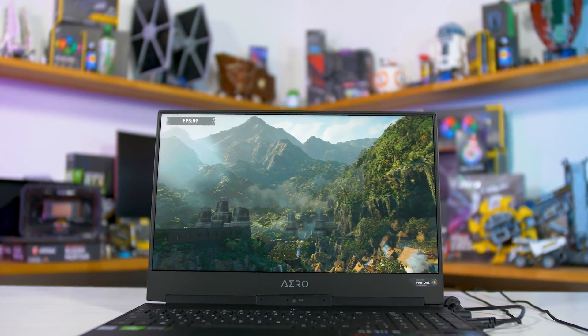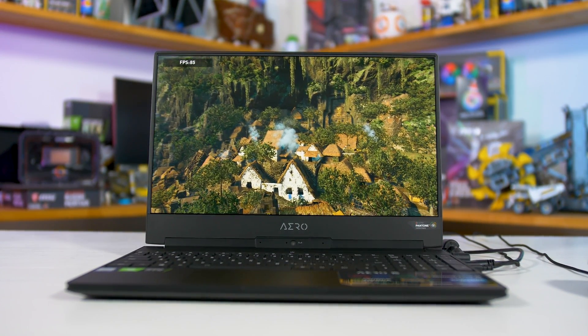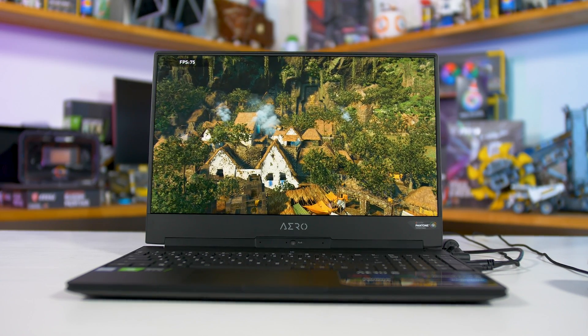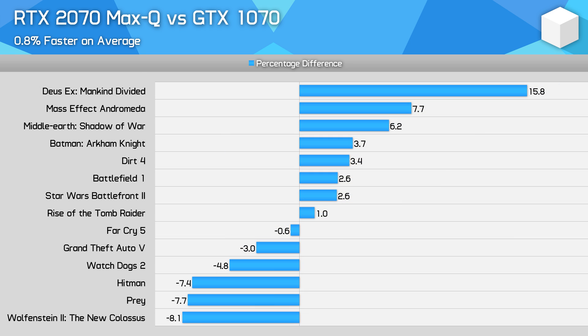For gaming performance, I've already done a full breakdown on the Nvidia GeForce RTX 2070 Max-Q used in this exact system — it's well worth watching that in-depth video for a look at each game and more discussion on the GPU in particular. The new Aero 15 X9 is 11% faster on average than the Aero 15X V8 with the GTX 1070 Max-Q, and this margin is typical when comparing the Aero 15 X9 to other 1070 Max-Q laptops. Do note that the version with 16GB of RAM is only single-channel, so those upgrading from a dual-channel laptop will see smaller margins. However, there's not much to be gained moving from a fully-fledged GTX 1070 to an RTX 2070 Max-Q as performance is roughly equivalent. It's nice that new laptops include more performance in the same form factor, but the increase isn't massive.